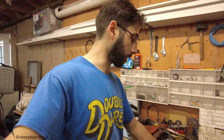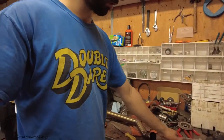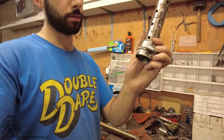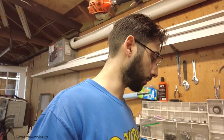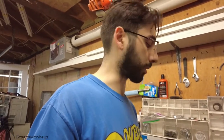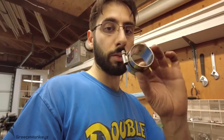I got the silencer and I got a little sleeve I'm going to weld to it — kind of like that — and it should slip into the tailpipe. I'll probably put a rivet, or maybe a stainless bolt. I like the stainless bolt idea. Maybe I'll tack a nut onto the inside of this so that it can be bolted together, plus it has to actually hold them up.